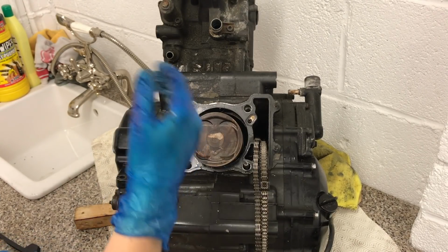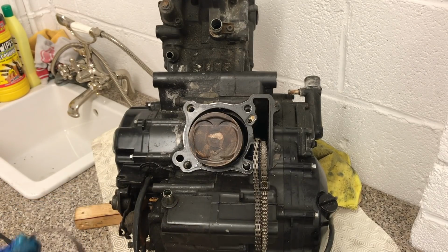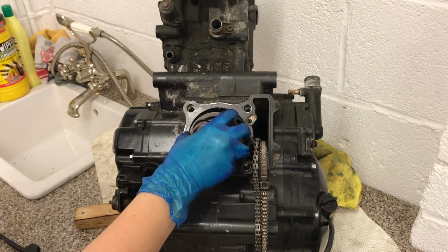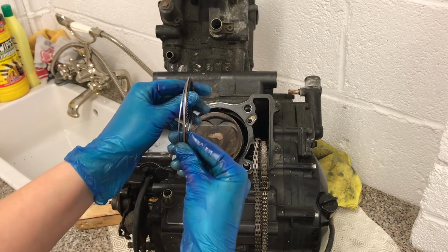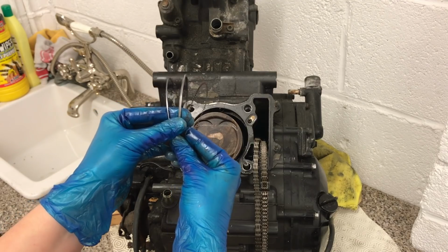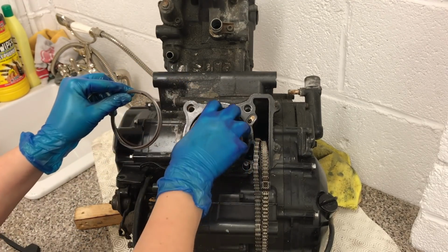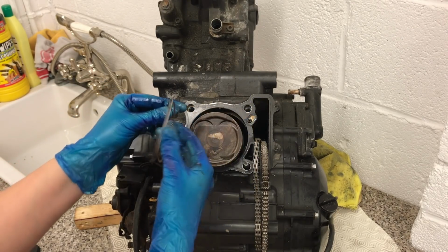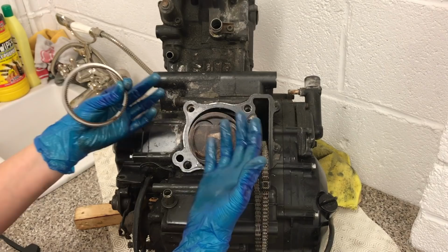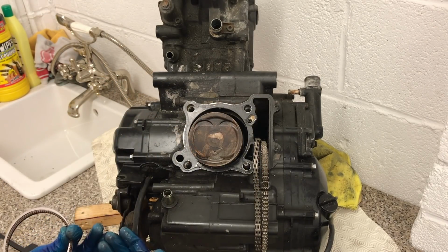So I mentioned at the beginning that an important part of the engine process is compression. I've taken them off for the purpose of taking the engine apart, but what happens on pistons is they actually have these piston rings around the outside of them, and the reason for that is it makes sure that there's absolutely no gap between the combustion chamber and the piston head. And the reason that's so important, of course, is if there's a gap then air could get through, which would mean you wouldn't get such high compression.